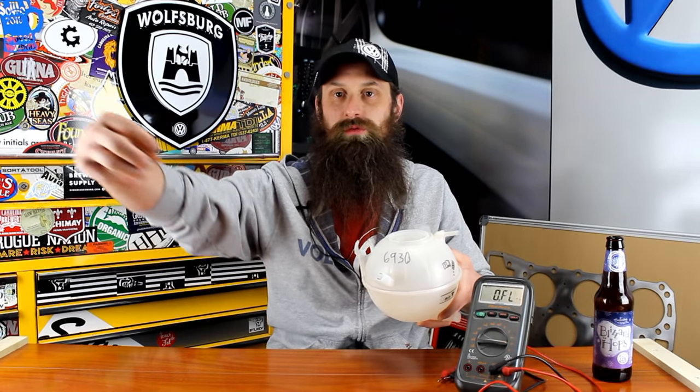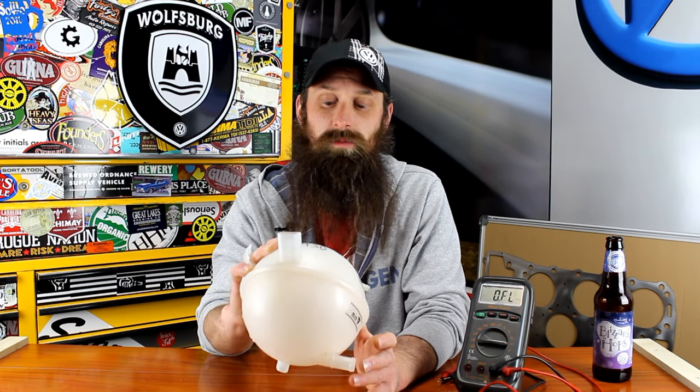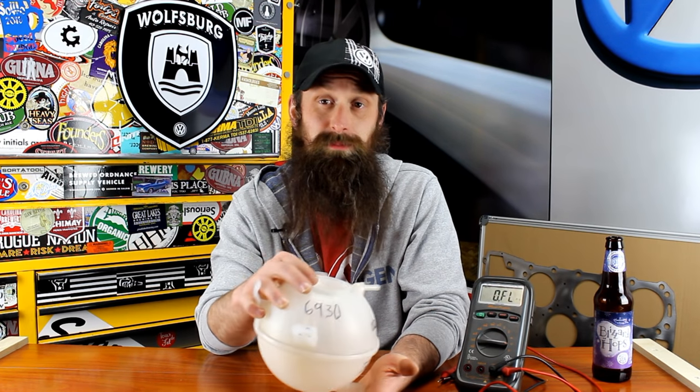I've also seen this fail in a really sad, unhappy way — and that's when the inside of the connector housing starts to leak and coolant is pulled through the entire wiring harness. I've seen more than one vehicle body harness on Mark 4 Jettas have to be replaced because this failed and actually got coolant through the entire wiring harness of the vehicle. You know it's a bad time when you take the connector for the fuel pump out and it's full of coolant. It's not very common, but that coolant migration can cause big damage — harnesses and modules replaced.